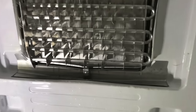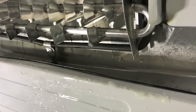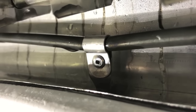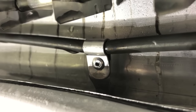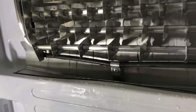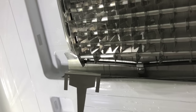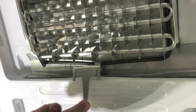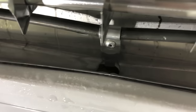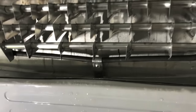Now that I've got the panel off, I want to show you where the ice dam was forming. You could actually chip away ice from this lower part. That little silver piece is the factory clip that's supposed to defrost that ice, and it doesn't do a very good job — lots of people are making these kinds of videos on YouTube with the same issue. I ordered a replacement clip that gives more surface area to the heating element and transfers more heat into the hole where the water is theoretically supposed to drain.